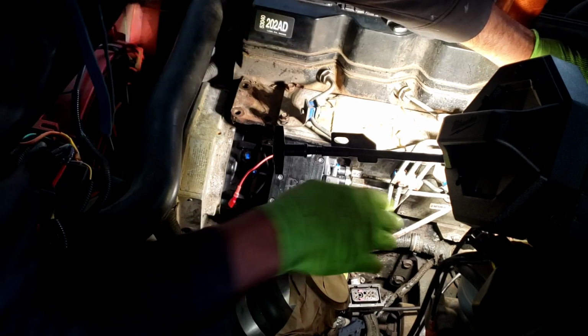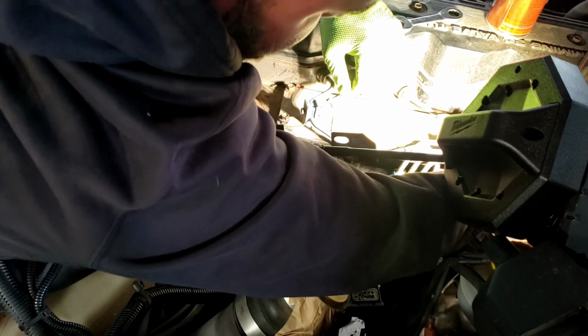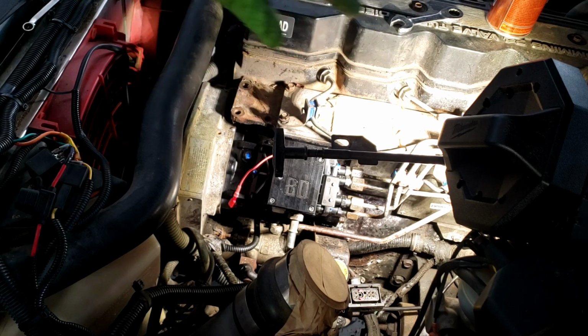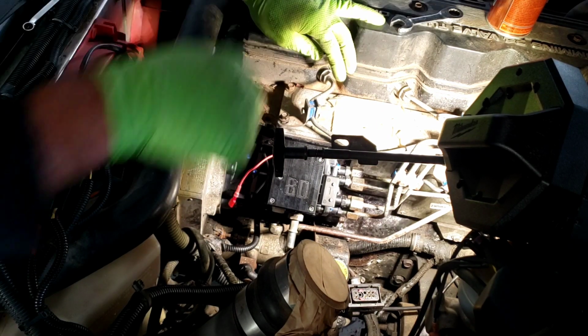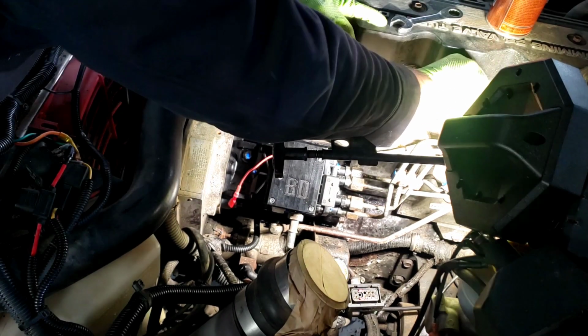A bit of a time getting one of them started. You'll take the end of the line where it goes into the cylinder head here, and if you just push that line into the cone, that thing will usually thread on just about every single time. Now that I've got these started, I can go ahead and put my bolts in if I want to. I can tighten the lines up. I do like to go ahead and start them.